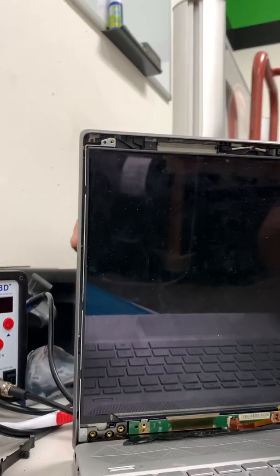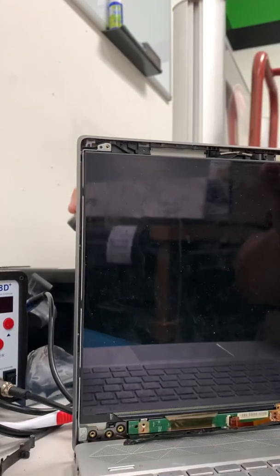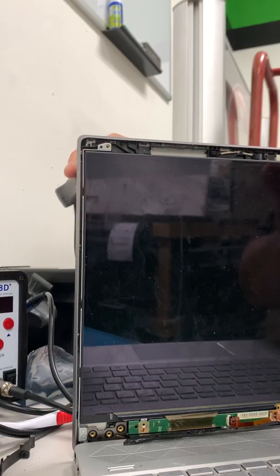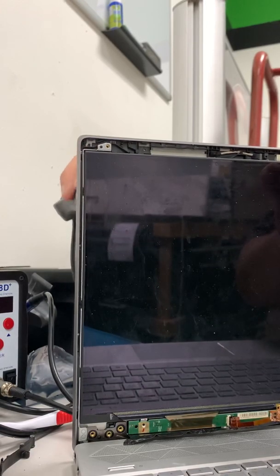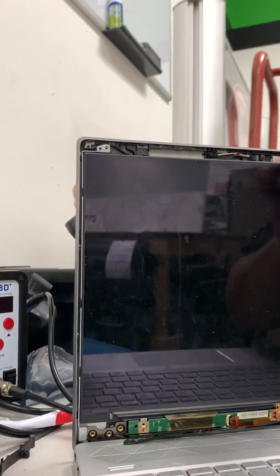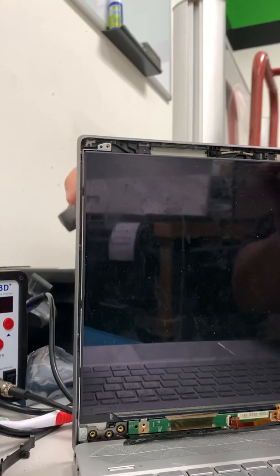So I'm going to heat up the back now. I'm just going up the side because it's basically right about here and I really just want to get it started. 250°C is kind of a lot for this, but it's aluminum, I don't see any problem providing that much heat in this area. We're replacing the screen anyway, even if I was to overheat the screen and cause one of those burn marks, it's not a big deal. But really, it's about getting it open just enough so that we can peel that piece out.